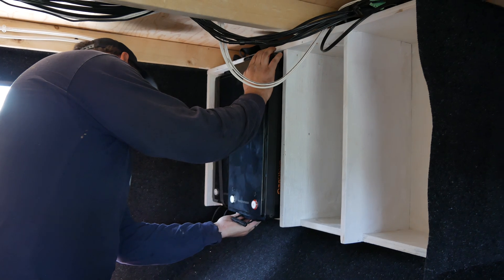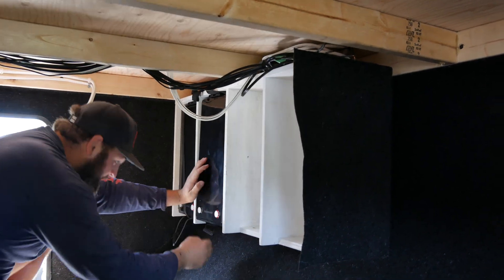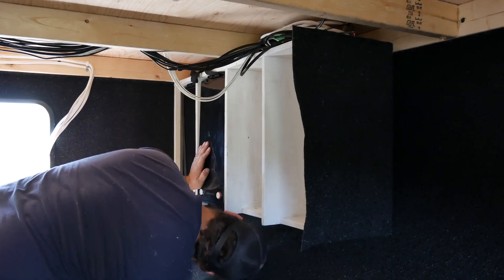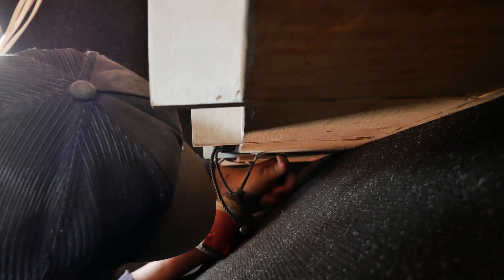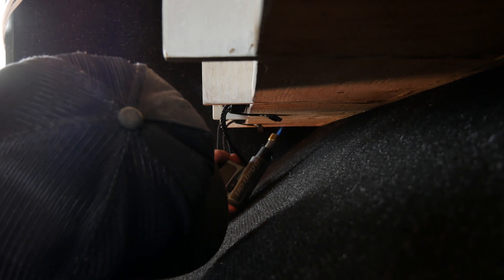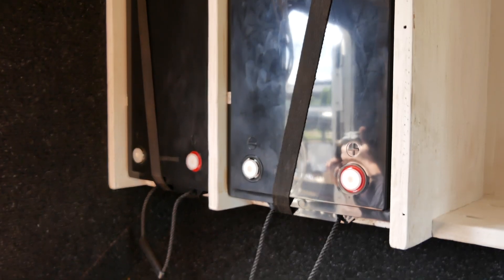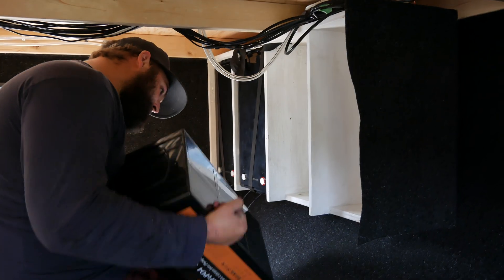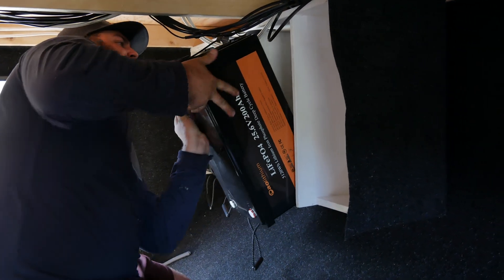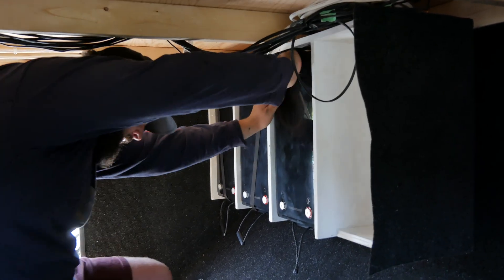Some of you may say you can't put your battery like that, like it's gonna spill out. But this isn't a typical lead-acid battery — this is a lithium battery. You can put these batteries in whatever configuration you want: upside down, right side up, sideways, whatever way you can possibly mount it. The reason for going with lithium is there's much more usable power. I don't need to watch and only go to 50%. You can go to about 10% without damaging the batteries, so you actually do get your full rated amperage out of them.